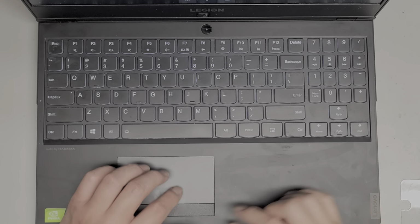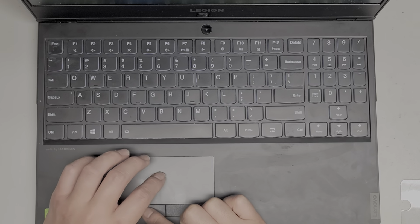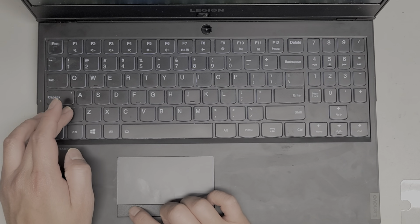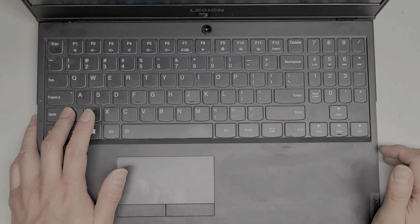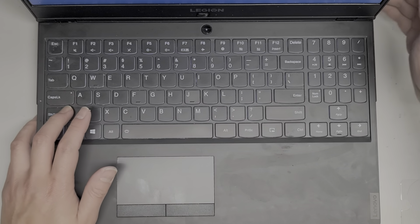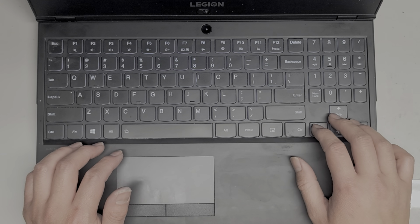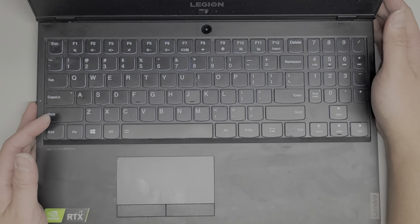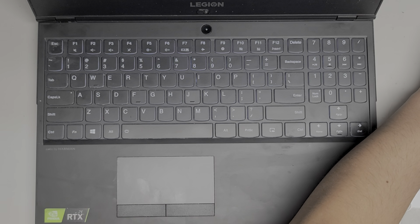I don't know the password, so I'm gonna try and boot from something else to see if I can figure it out. Actually, let me try doing the recovery mode. So I'm holding the left shift key and I'm clicking restart. This will give a please wait option on the screen. And hopefully I can go to troubleshoot, and then hopefully it will let me go to the command prompt. It'll probably ask me the password. If it does, then I can't do this. And I'll try and boot from my USB to test it if that's the case. Let's see what's going to happen.